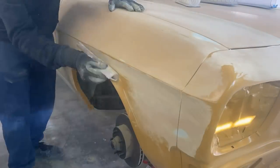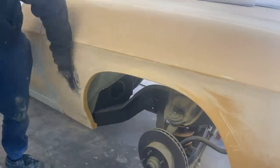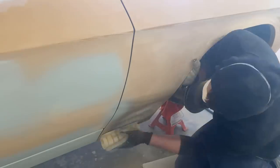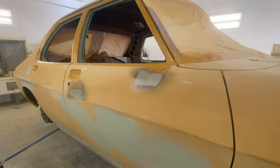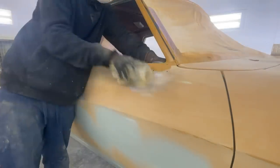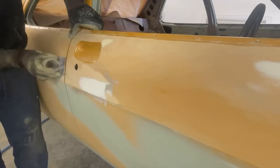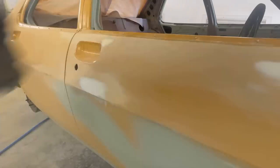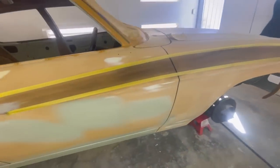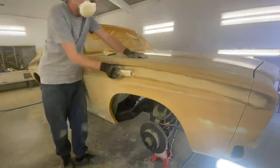With that filler drawing off I decided I would focus my attention on the lower half of this guard. There are a few tricky areas in these guards mainly around the wheel arch - you may notice a few points where I do break out the old broom handle stick, wrap that up with a bit of sandpaper, and I find that kind of finds its way nicely in around that curve of the wheel arch lip. Back on these little repairs now that they've hardened up - just using some 120 on a hard sanding block, then follow it with a little bit more guide coat, slightly larger sanding block with a bit of 180, and that sort of finishes it off nicely. The filler I've put into those spots is the 3M Platinum Plus Fives, and I was actually quite surprised working it into the Resto Finish Poly Primer - it actually did stand up very similar, so it was really good over the top of that. The two complemented each other really well.